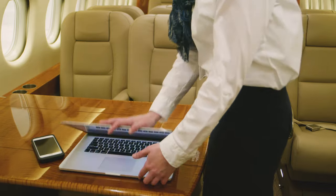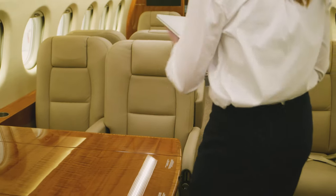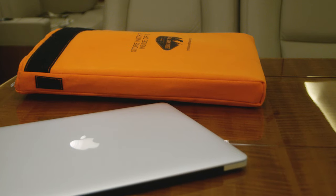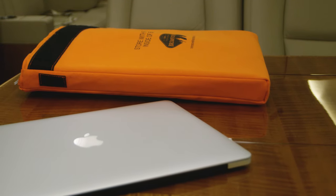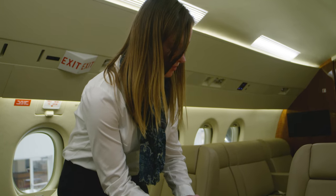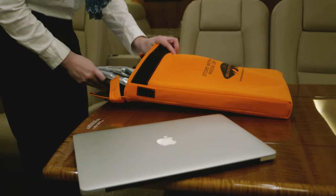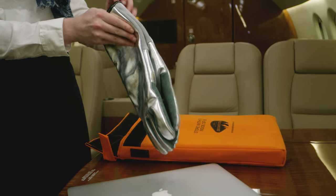A smartphone, laptop, or other battery-powered device is experiencing a thermal runaway when you notice swelling, smoke, or intense heat. Place the preventer bag next to the malfunctioning device. Next, remove any safety items your operating procedure calls for, such as gloves and the instruction card. Quickly don the required safety equipment.